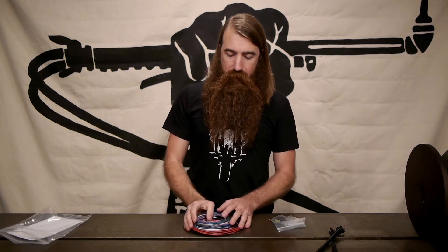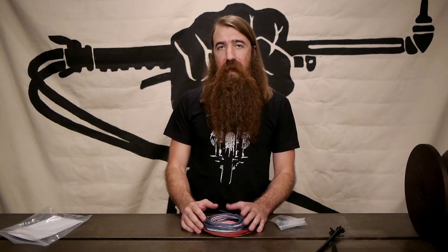We've got the heart of the kit, which is this wire. This is a specific type of wire that has a cross-linked polyethylene insulation on it, and that cross-linked insulation has a much higher heat rating and better chemical resistance, so it's impervious to fuel, gasoline, alcohol, oil, grease, coolant, and any of the other chemicals and fluids that you'd find on your motorcycle. It can also handle the higher heats that you'll have underneath the fuel tank and near the engine.